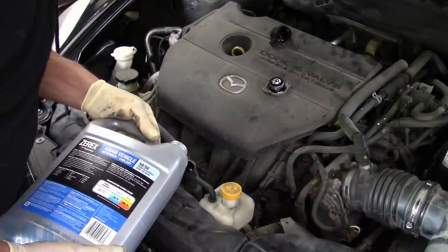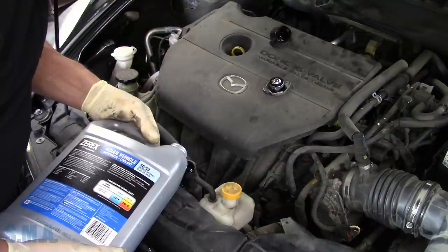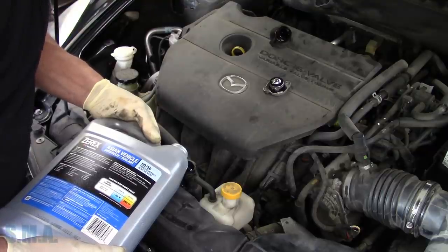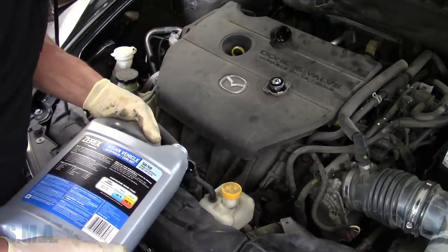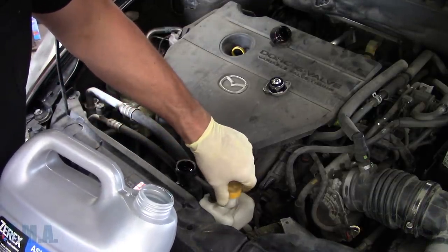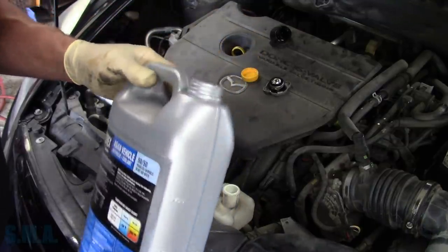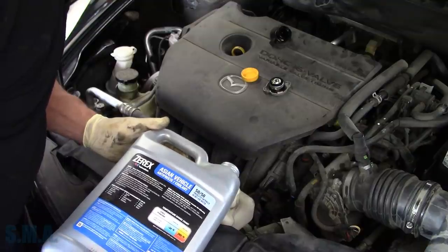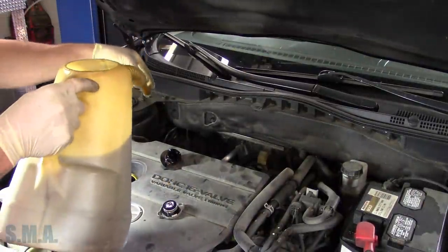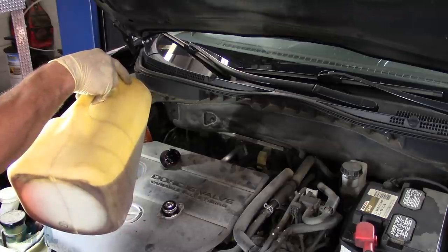I know the factory stuff is dark green, this stuff is blue, but chemically it's 100% compatible and that's what you have to consider, particularly if you're mixing it like this. You don't want to go dump in your global universal nine-dollar advanced auto special one-size-fits-all coolant — that stuff is only good if the system has been completely flushed and refilled. If you're curious what fluid to use, you can call Valvoline at 1-800-TEAM-VAL and they'll tell you which one of their products is compatible with your vehicle. Fill her up with the oil and make sure you put your drain plug back in, because if you don't, that's embarrassing — that's how I know.